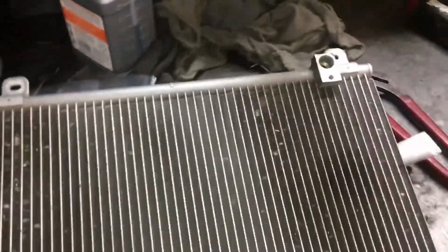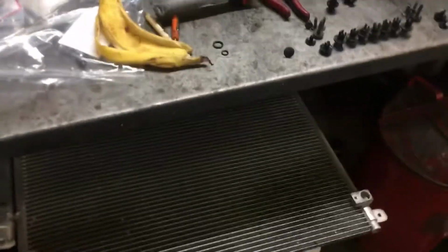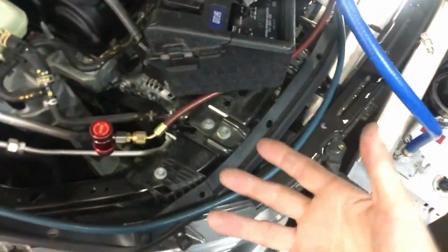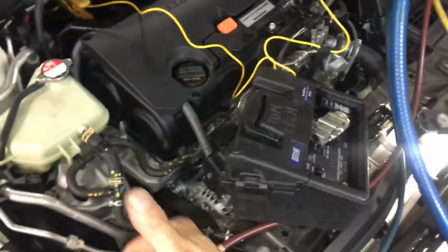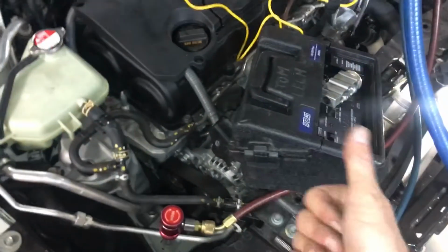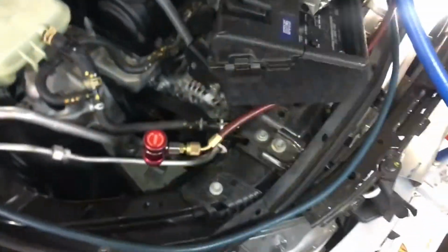And you let your customer know, well, Mr. Customer, you have been driving this for quite a while low on refrigerant, and I know you didn't know it, but you were also starving your compressor for oil and starving your compressor for cooling at the same time while you were trying to operate it, because it had a leak in it and it ran low on refrigerant. And an AC compressor relies on what? A full charge of refrigerant to bring all the cool spray of oil back to the compressor again to cool it down, one, and lubricate it. But without a full charge of refrigerant, it doesn't all make it back to the compressor to do its job.